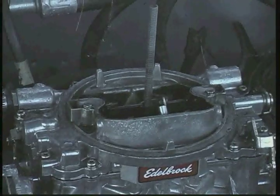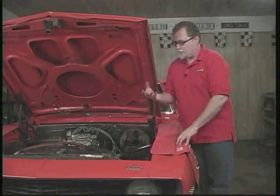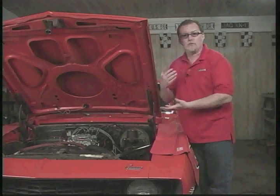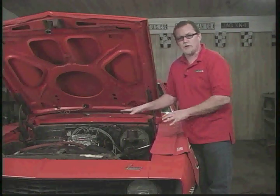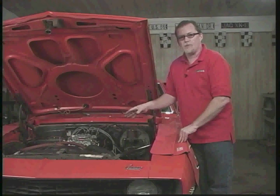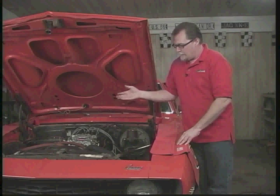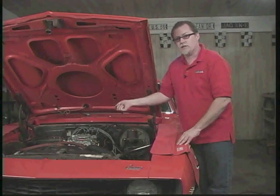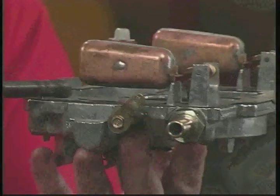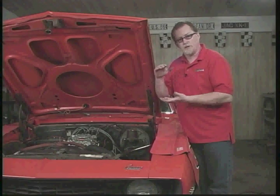It's a real fire potential hazard, so you want to be sure that problem gets fixed. Another problem could be that the fuel pressure is too high. If you have too much fuel pressure, it'll blow fuel right past the needle and seat — it's not strong enough to hold back the fuel pressure. You never want any more than about seven pounds of pressure going into the carburetor. Six to seven PSI is pretty optimal. If you know your fuel pressure's good and there's no dirt in the needle and seat, it could be just a simple float adjustment. You can take the top of the carburetor off, flip it upside down, and check the float levels with a scale or a 7/16-inch drill bit to see if it's at the correct height.